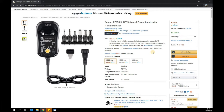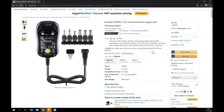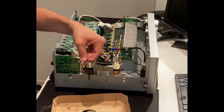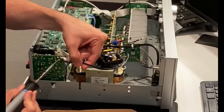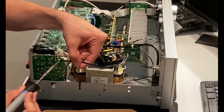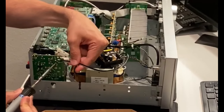The universal switching power supply unit is installed to provide the device with its own supply voltage for operating the fans. Since it cannot be guaranteed that sufficient power can be delivered for the two additional fans, the 12-volt supply in the AV receiver is not tapped. The switching power supply is integrated so that 12 volts are only present when the AV receiver is switched on. There is no need to build a switching power supply from scratch, for reasons of complexity and to reduce costs.